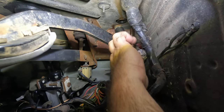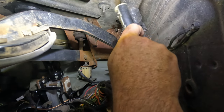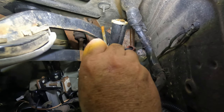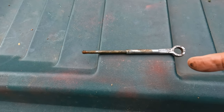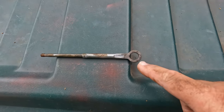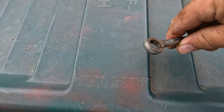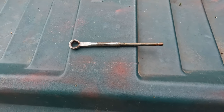The pin should just push straight out just like that. So here's my shaft — this should not come out like this, but it did. Let me take this out and examine it a little bit closer. This is the pin that goes into my master cylinder. I was wrong — the end of it is not broken off. You can see this hole right here is no longer round, it's oblong — it's worn on this end up here, pretty bad. So this thing has been needing to be replaced for a long time.